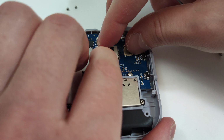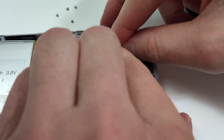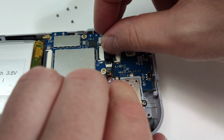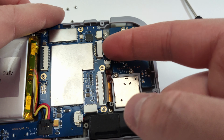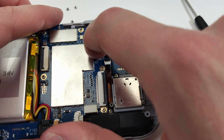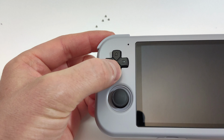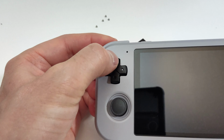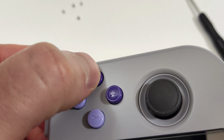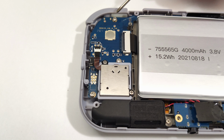With the lock still disengaged, we can now install the ribbon cable. This one's a bit tough, but installs easily enough. Engage the lock before we move on. We can see the progress of our work now that the upgraded board and membrane are in. Hopefully you like it so far. A couple people I've talked to prefer the buttons as is without the swaps, so if you prefer them, don't change them. I prefer the face button upgrades more than the D-pad side overall.